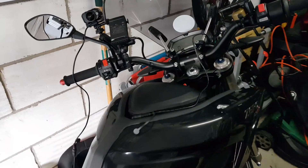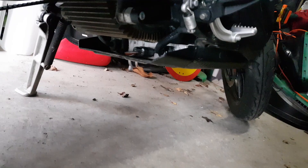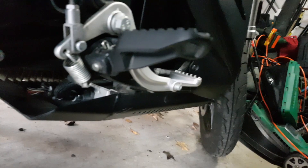It's the penultimate day of 2018 and this bike is going back to Street Bike in Halesowen because we have a problem. The first issue with this bike and the onboard Kalex charger — it has done what many of them do and decided to stop working. The actual symptoms are: plug it into charge, flick the switch on, and the consumer unit trips — the fuse blows if it were an old fuse box type setup.